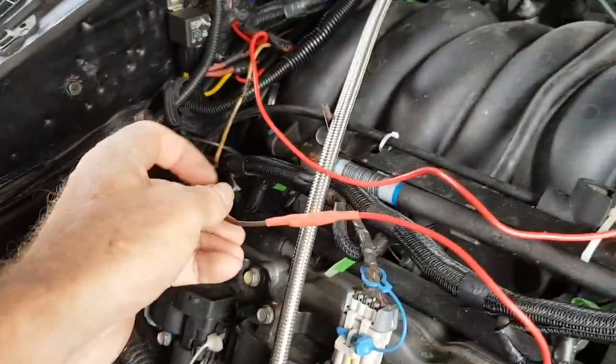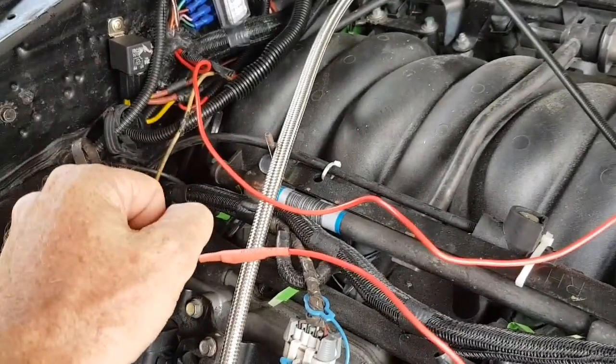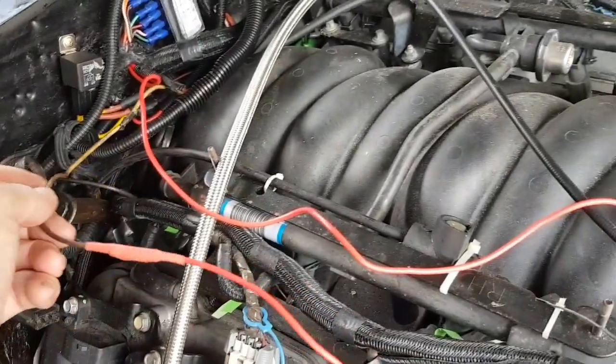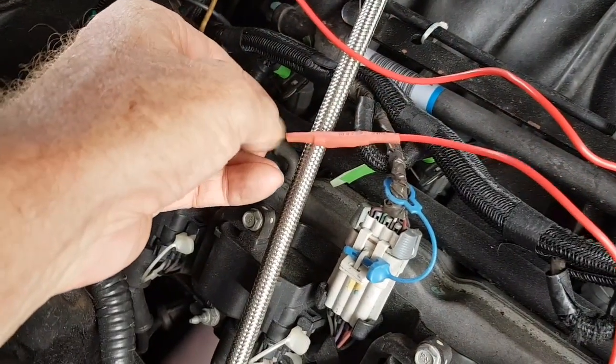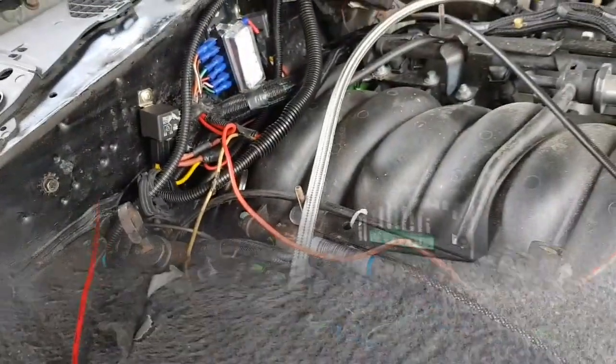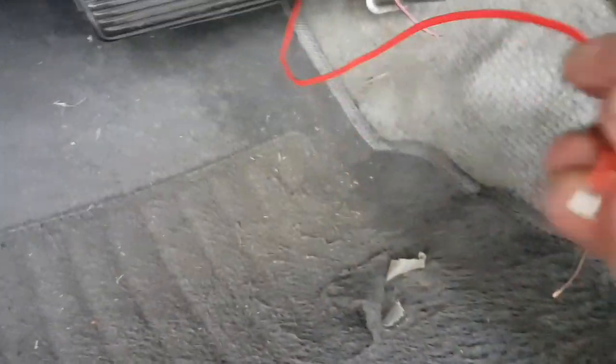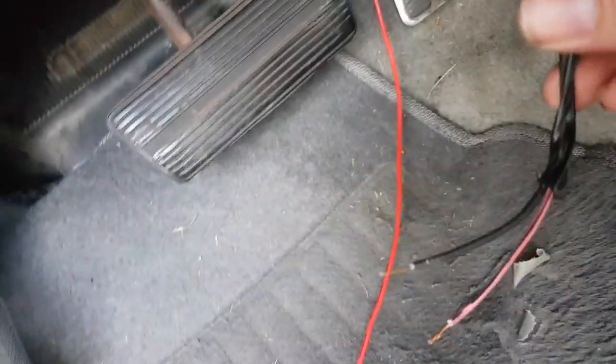There is the wire that used to be white — it used to run to the HEI on the Pontiac 301 turbo motor. I don't want to go chewing the cabling up in case I put the other motor back, which is all operational. All I did was splice in a feedback wire which goes straight back inside the cabin and I'm going to hook that up into the digital decoder. Here's our little unit, here's our PCM tach wire, here is the wire we ran from the white wire from the engine bay, and a couple of wires connected to a keyed positive on the pink and a ground on the black — and all we're going to do is hook those straight into these little jumper terminals.